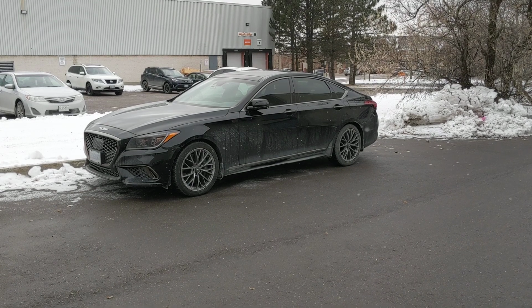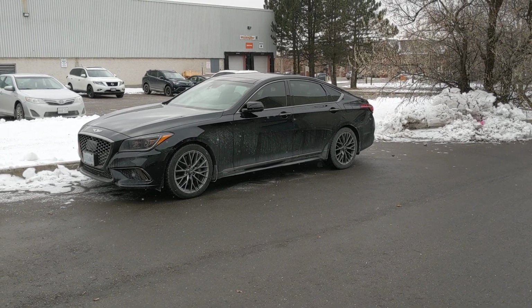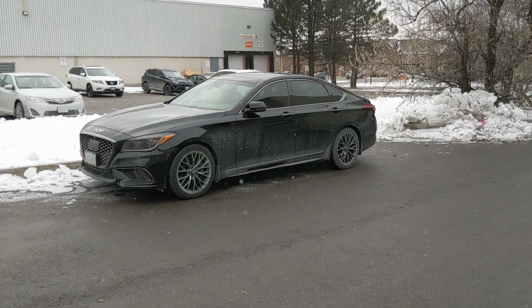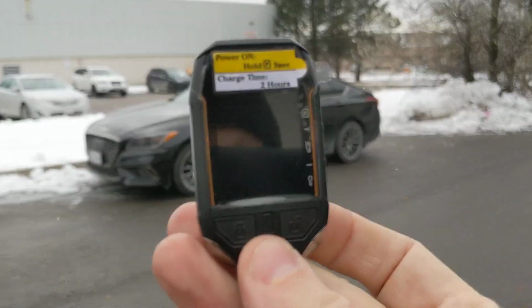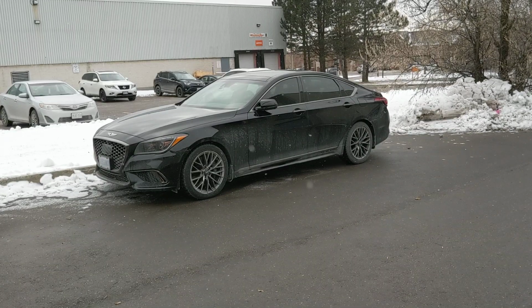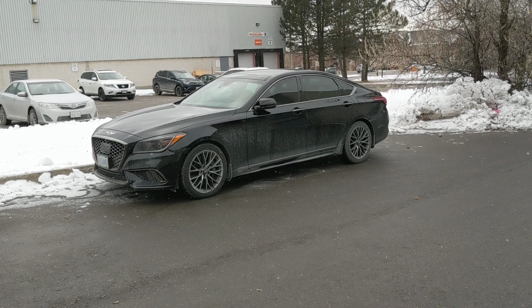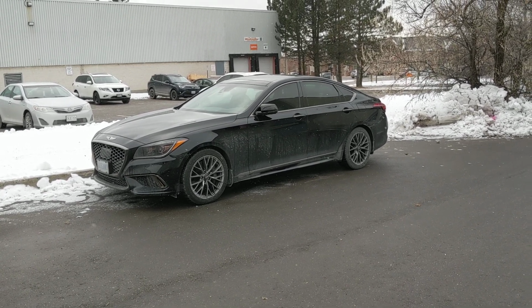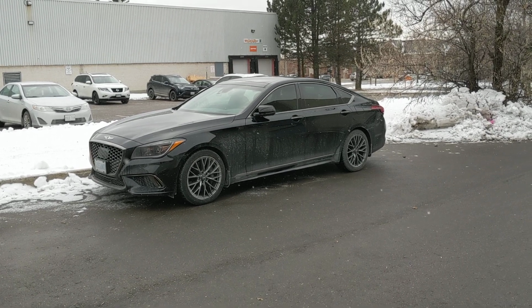What I'm bringing you today is a video of this 2018 Genesis G80 Sport that we just installed a Compustar Pro T12 remote starter, along with a DC3 controller and the iDataStart ADSTHR HK8T harness. We also installed the FT Alarmant kit, making this a full alarm start plug and play install on this G80.